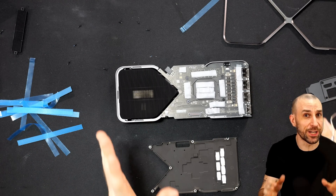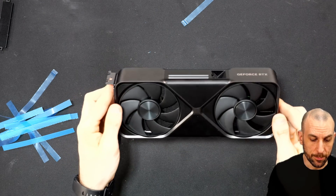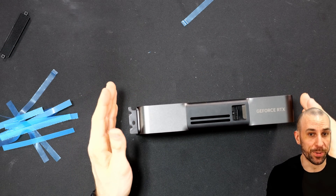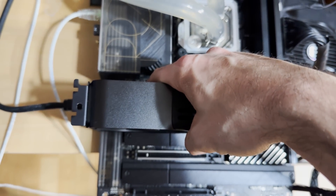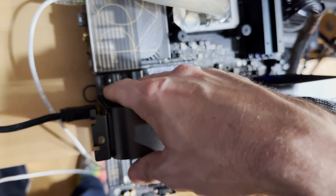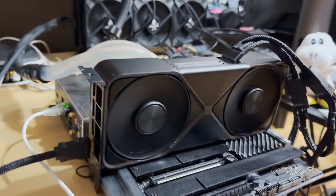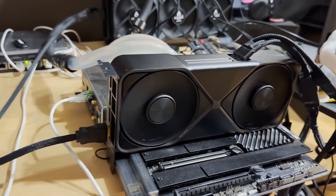If we can just reduce the temperature by like three or four Celsius, that would dramatically reduce the fan speed overall — that's the only goal here. She is all back together. I left the little grill thing off for now, just to see what the maximum thermal benefit will be. Back to testing — no difference. It's actually back to stock, and actually a little bit worse than if we just removed the grill. After all that, we made zero improvement. The backplate is actually significantly hotter, so the thermal pads are extracting heat to it, but there's no airflow back there, so the heat isn't going anywhere. That proved to be pretty fruitless — there is nothing you can do to improve the noise and cooling capacity of the 5070 Founders Edition cooler.